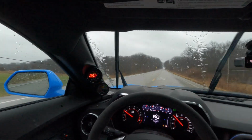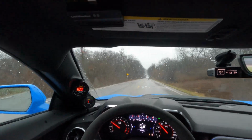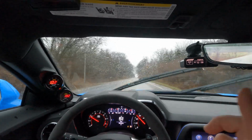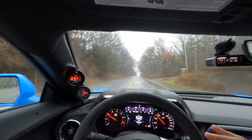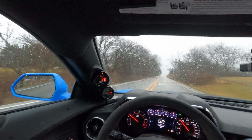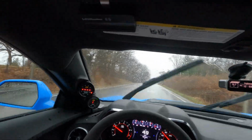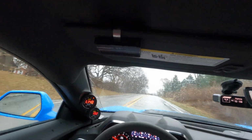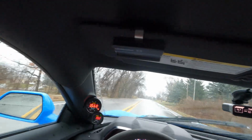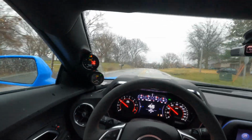And I'm telling you, go with the 4.9. Like I said earlier, it's the tougher sensor, wideband, you're gonna get the most accurate reading. I'm gonna be trying to do street tuning with this, so I'm gonna try to find, it's dipping down in the 9s, 0.9. I can live with that, man, for sure. I think I can live with that. That's really not that bad.